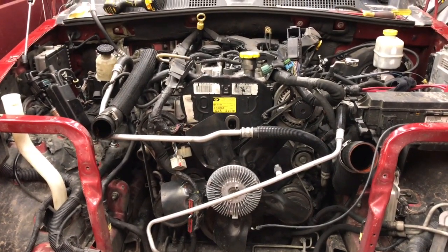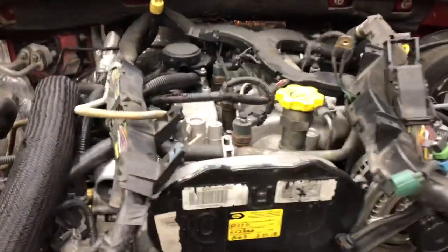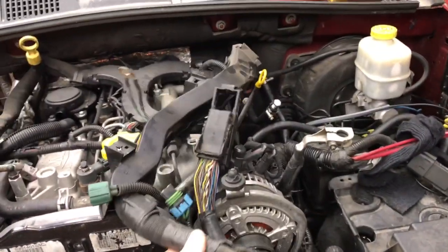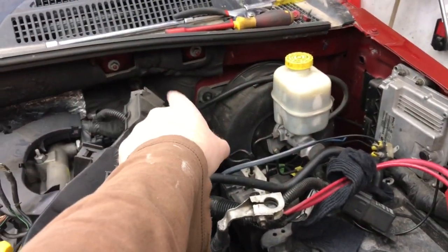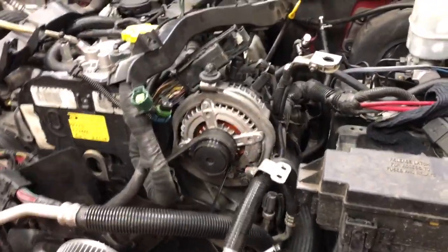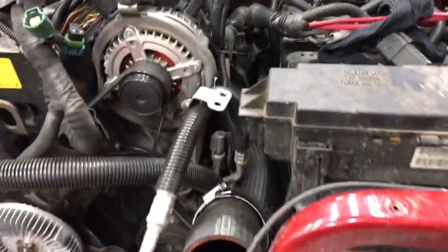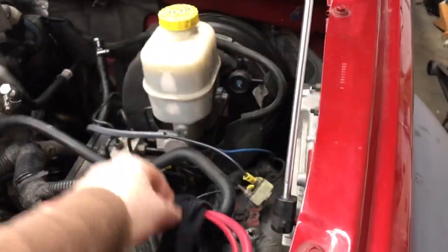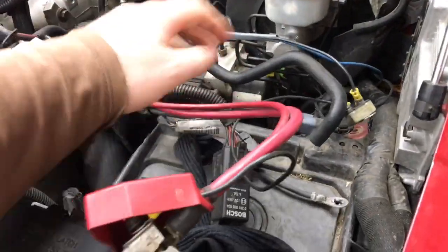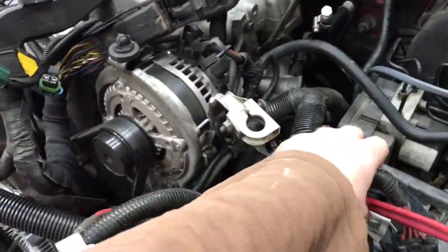So the way I do this is I've got the wiring harness all pulled back. Normally that runs along the firewall back over there. See, it plugs into the transmission computer back here. And the same thing, I've got this bit of the wiring harness, which normally runs behind the fuel filter head and back over and plugs into the ECU. I've got this all apart. So there's everything together. The harness runs down and around. It goes back to the transmission. We've got the battery cables, everything. See, this is all disconnected. Minus that, but this is all disconnected and that'll stay on it.